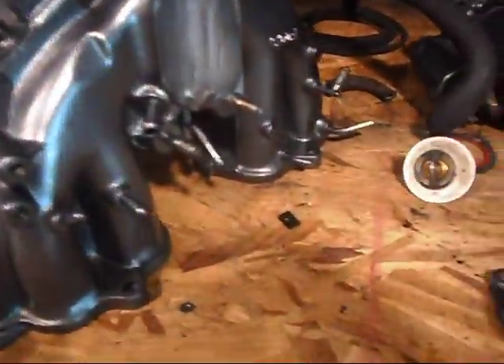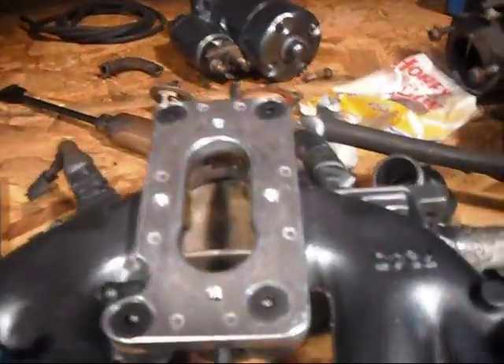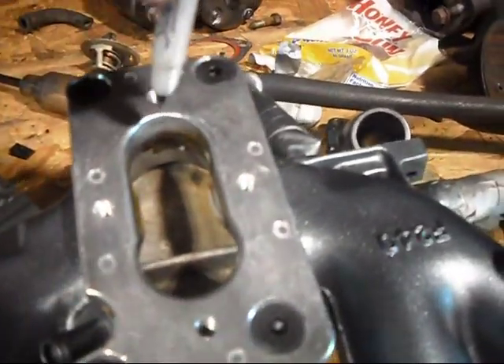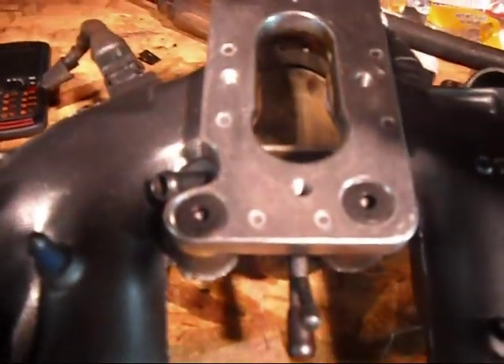Did a little spray painting on the intake pieces — got bored, wish I was putting that on there. This is the rest of the motor waiting to get back from the shop. Engine rebuild — I think it's going to cost us $900 from Poteet's in Kannapolis, just trying to get something more reliable. Went ahead and mocked it up and took a real fine pen, went around marking where there was excess, making sure I could trim it back, and made sure my gasket was trimmed good. I'm going to get in there with a Dremel once I set these three plates together and make sure it's all smooth.